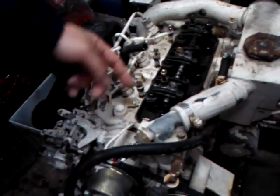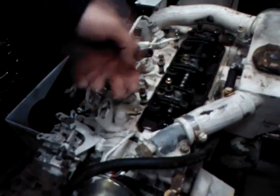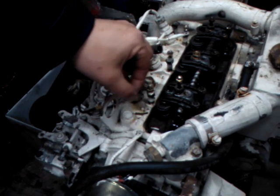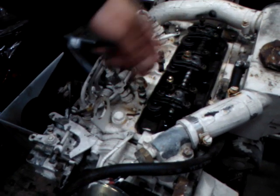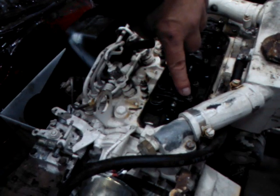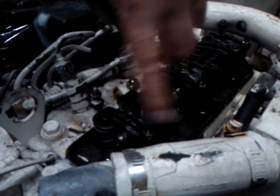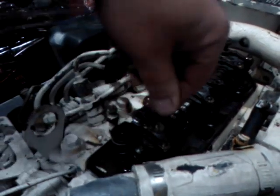You're going to adjust — you're adjusting. All you're doing is loosening here, and you put the feeler gauge in, and you just keep sliding it back and forth, give it a little turn, back and forth. And I see this one's got a head on it for, like, a screwdriver. So you're loosening it and adjusting it.